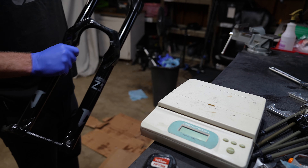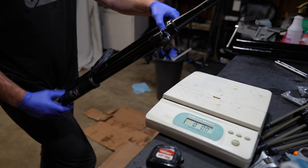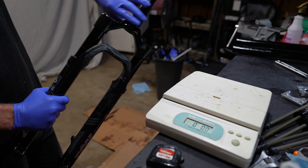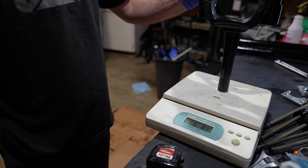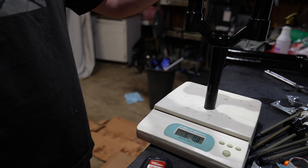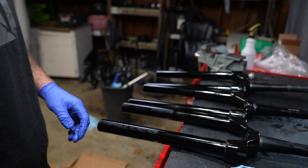The last part of the chassis to inspect is the lower legs. The most important thing about the lower legs is the bushings — they're like brake pads inside the lower bushing and they hold onto the upper stanchion. If they're too loose they make noise; if they're too tight they create friction and the fork doesn't feel good riding. The Fox 36 Rhythm has horribly tight bushings — I literally have to hammer the upper tube into the lowers. The 2024/2025 Z1 e-bike chassis has new bushings so the upper and lower tubes slide together super easy. And the 2019 Fox 36 upper and lower tubes slide together like butter, just like the modern Z1 e-bike chassis fork.